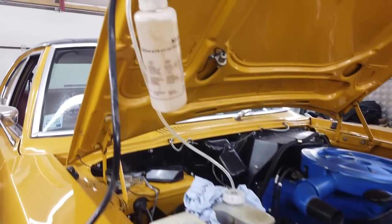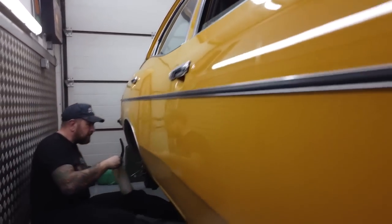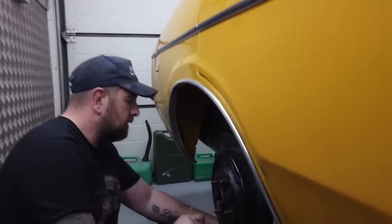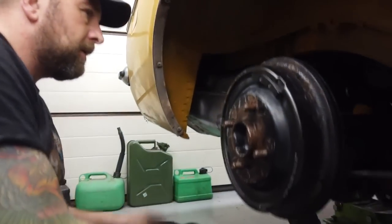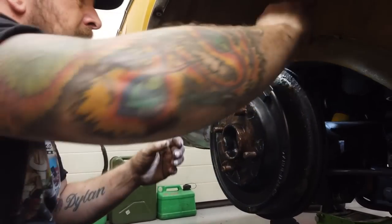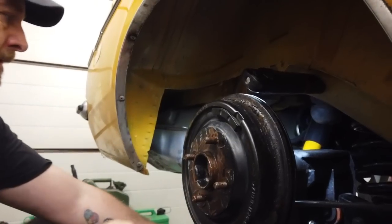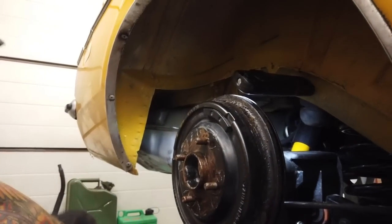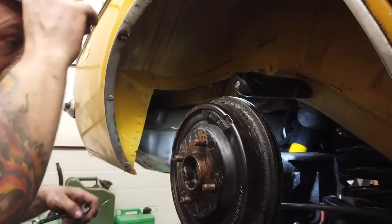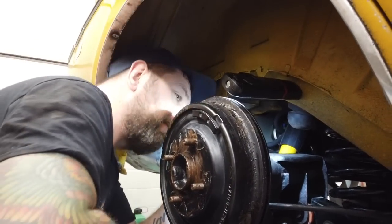With the axle all assembled, we're now going to bleed the back brakes, because of course when the axle comes off, we've got to take off the back brake line, which introduces air into the system. So we'll Easy Bleed the back axle. As you probably know, there's only one bleed nipple because it feeds through the other cylinder and out this side. That's on the off side. Richard loosens up the 11 bleed nipple, connecting the drain tube for the Easy Bleed.